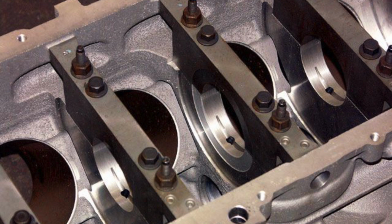One of the many reasons the Chevy LS is so good is its strength. After all, what would a good engine be without a solid foundation? Chevrolet designed the Gen 3 LS block as a Y block. This Y block design helps increase rigidity in the main cap area by using 6 bolt main caps on the crankshaft. 4 bolts are facing vertically and 2 bolts horizontally that clamp the block wall to the main cap. This is what GM engineers call snap-fit cross-bolting. This design provides great crankshaft and block rigidity. Previous small block Chevy engines did not use this design.